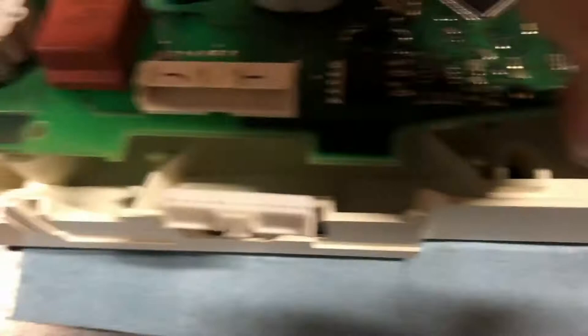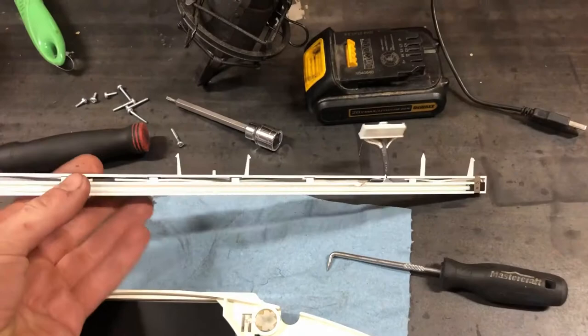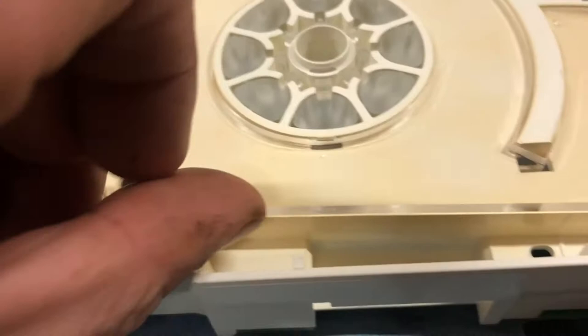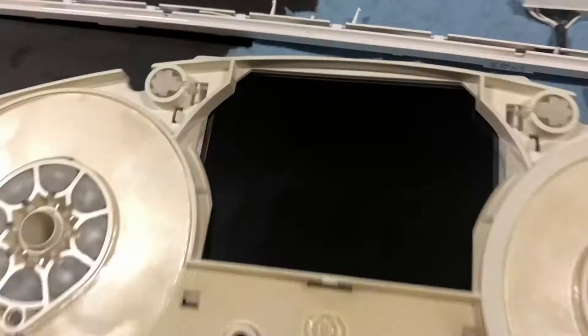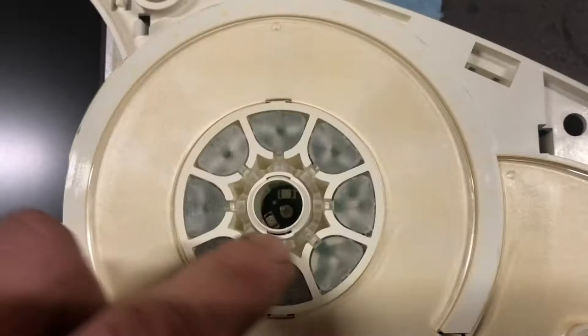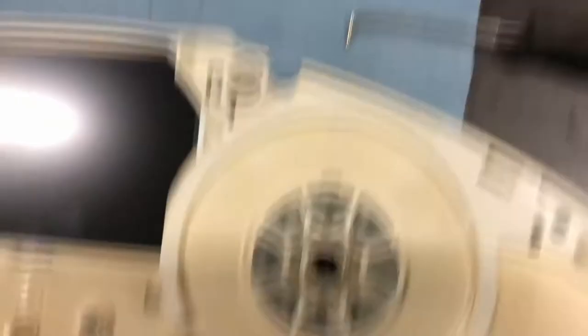Here it is out — here's the face. That would shine up on this glass and illuminate everything. You've also got LEDs for all your warning lights as well as the needle lights down in the center — those are all LED, whereas the backlight is CCFL. There have been a few DIYs on converting this to LED — you basically put an LED strip in, but you need an external power source because these work on AC voltage, whereas most automotive LEDs are DC.